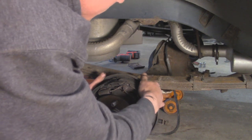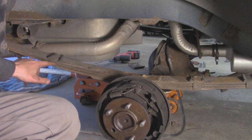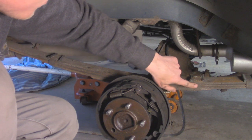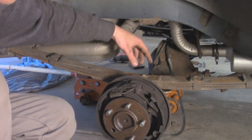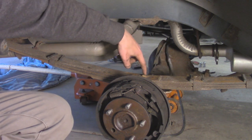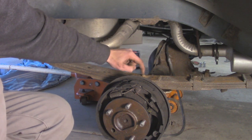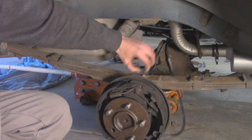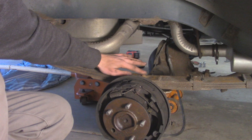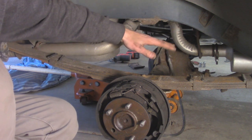Now our axle has completely disconnected from our leaf springs, and the next step is to cut off these old factory leaf spring pack holders. I'm just going to take a cutoff wheel and zip off these three right here, then take a couple of C-clamps and clamp the pack together, and then cut off the center bolt because it's most likely going to be rusted — and it actually is. Normally there's a top nut right here; if yours isn't rusted you can try to spin it off since it's just a stud. But we're just going to end up cutting that, and then our leaf pack should come undone once we start loosening up the C-clamps.